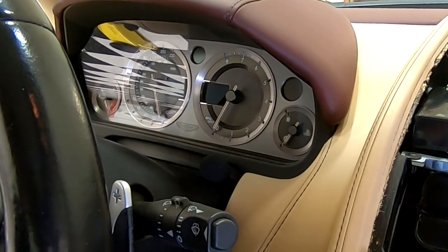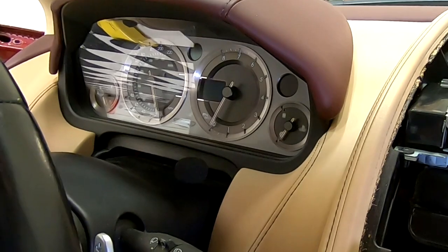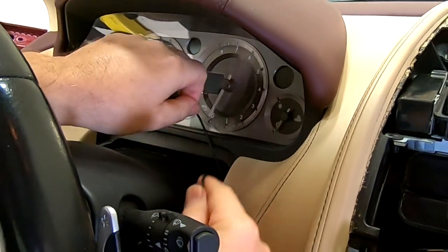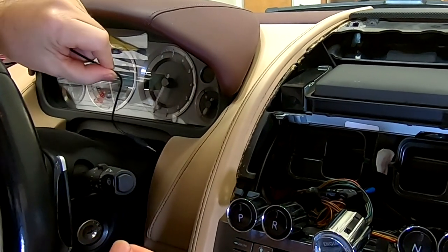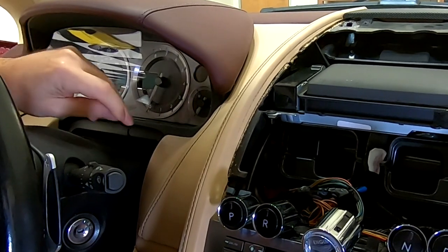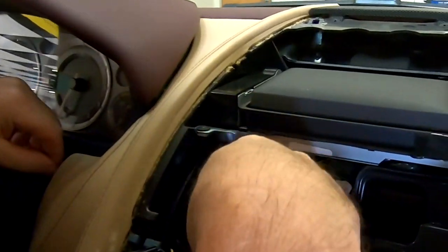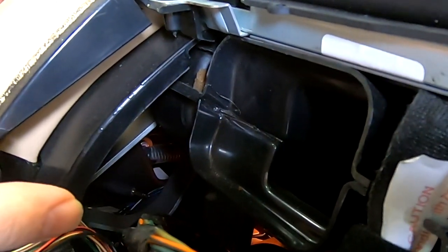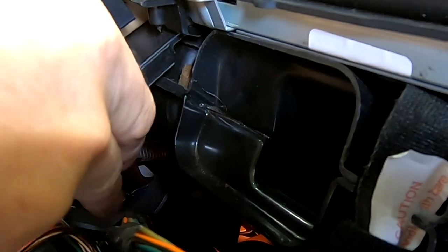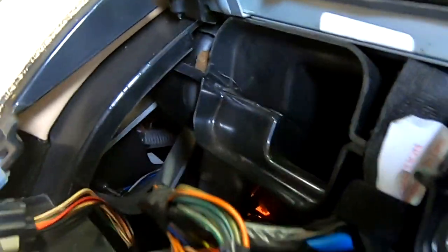One of the other advantages of this location, though, is simplicity of the wiring. You're literally talking about slipping this end of the wire into the gap here, and I'm not sure if the cameraman can show it or not, but on the diagonal through here you can already see the end of it. So you go in there with your long needle nose pliers, grab that, and bring the cable over up into this area.